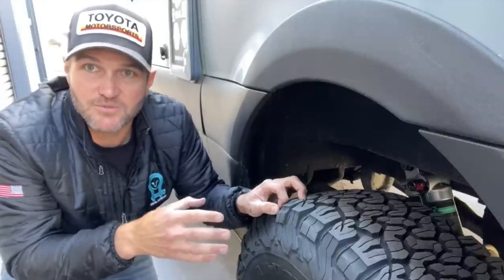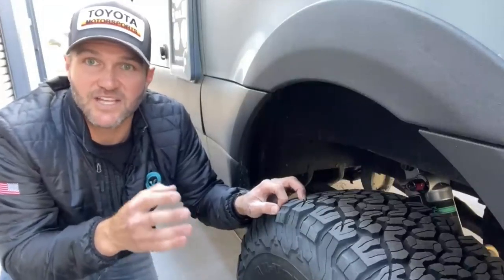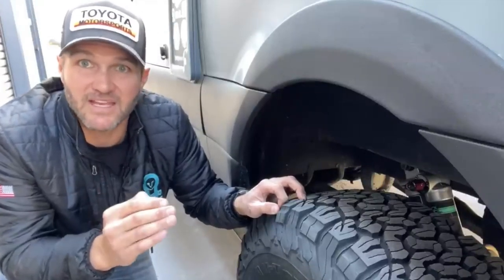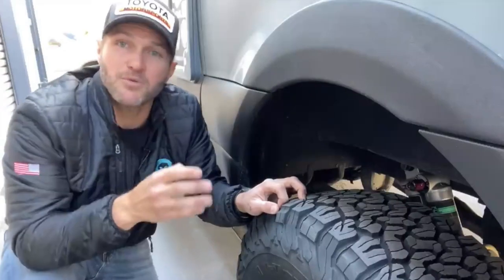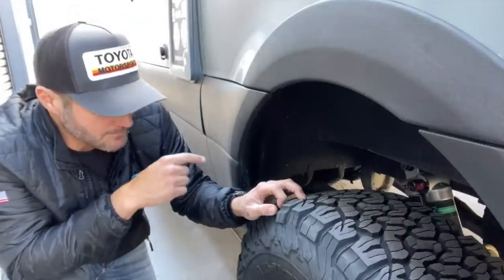They don't want people to show up to a Mercedes dealership, test drive an empty cargo van, and be like, this thing handles like garbage. So what do they do? They make it sprung for an empty van. It makes it handle great on the test drive, but the moment you put stuff in it, it collapses the spring, and it handles like crap.